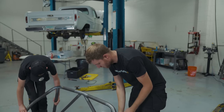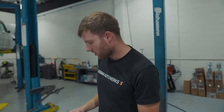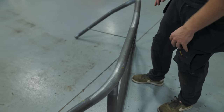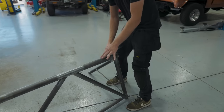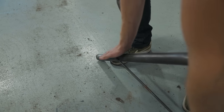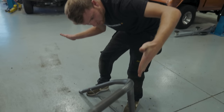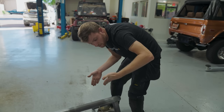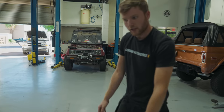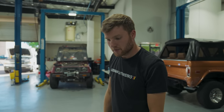That's essentially the half cage now made up. We've broken away the tacks so we can get it out of the car, so Chris can do really nice welding on the bench — much preferred over doing it in the car. We've put some rebar in because it's literally just to keep the hoop from tucking in while the pipes are welded — keeping it triangulated so that when it's welded it doesn't change positioning, meaning when we put it back in it will sit in exactly the same place.